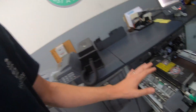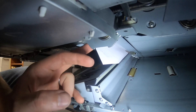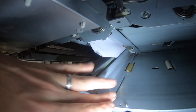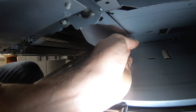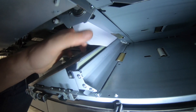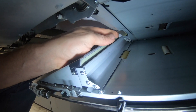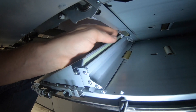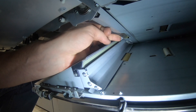So this is running actually pretty good when it comes to large sheets of paper, but if I'm printing 8.5 by 11, I still get an error. This is what it looks like underneath — my sheet goes around, comes down, and doesn't go any further than that roller there. I cleaned this but it feels funny. It feels as if the belt that is driving this will sometimes miss. I'm assuming that for large sheets it's fine — it's okay if it misses a little bit because it catches up. But for these small sheets, it's not feeding past there.